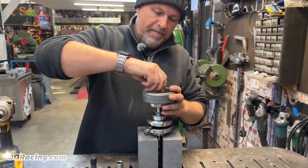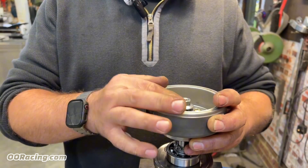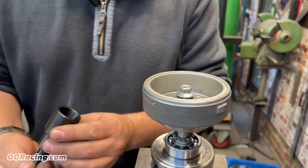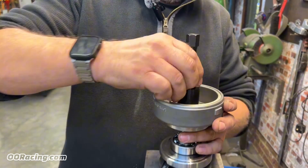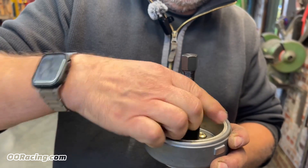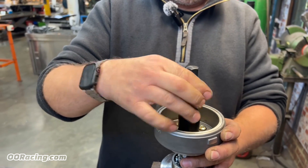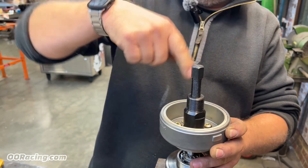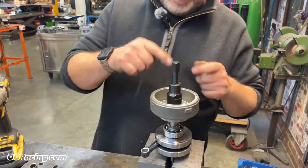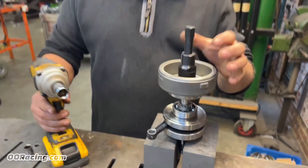So the key is: undo your nut and spin it on so it's level with the end of the thread, like so. Make sure your puller is fully backed off, then thread it on right the way up to the gunnels. Wind it down — you don't want to fly in with your impact gun straight into the nose of the crank, wind it up till it just touches. Also, put a dab of grease on the end — I've not done it in the video, but a dab of grease just helps it slide a little bit better.